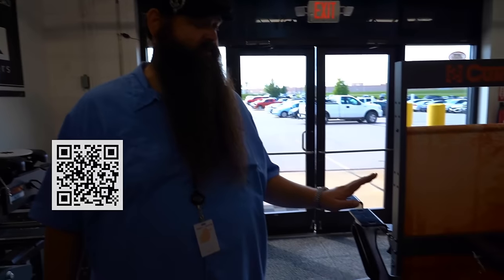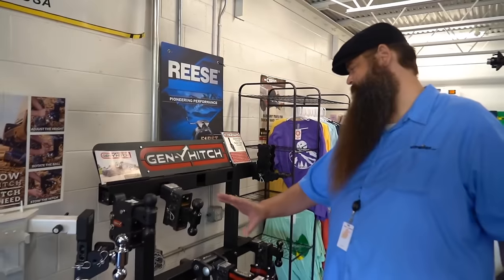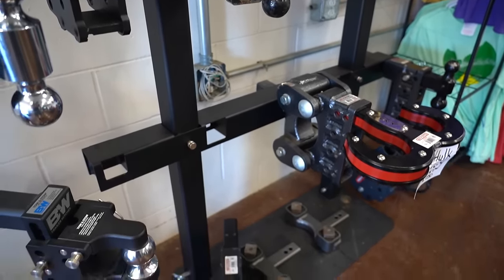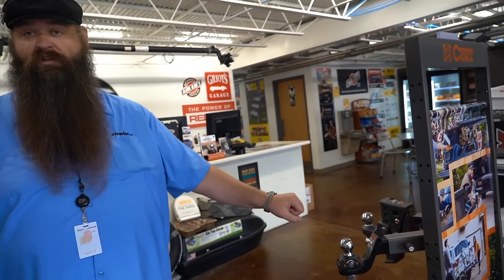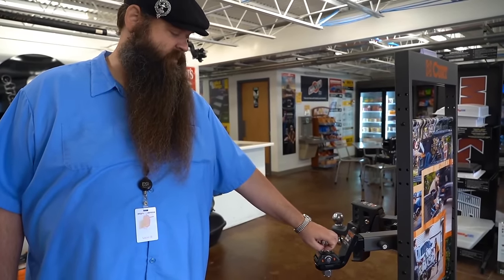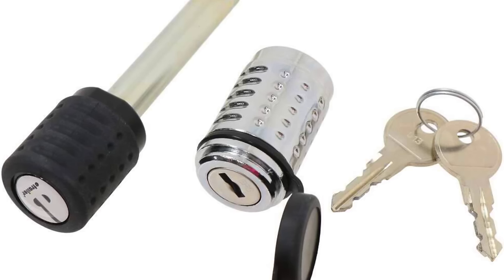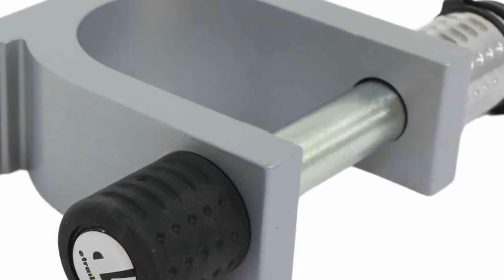If you're going with a travel trailer, once you have your hitch, you're not done yet — you still have a couple things to do. Come over and look at these ball mounts. These are your more premium options because they're adjustable. Some of them have little shocks in them to make it less jarring when you're starting and stopping. This right here is your more standard ball mount — this is what goes inside your hitch. The coupler for your travel trailer is going to lock onto this and be able to turn on it. And of course your safety chains that you always cross. We do like to recommend locks instead of just your standard pin and clip. There are unsavory people that like to walk away with things, and this keeps people from walking away with your ball mount when you're out on the road.